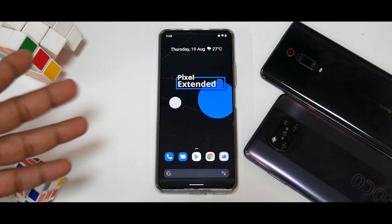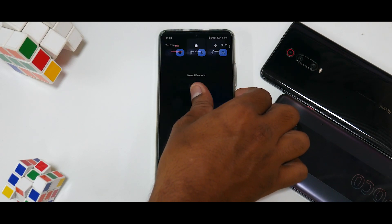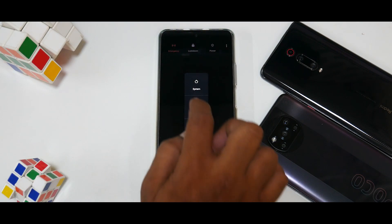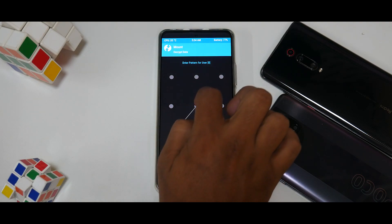Make sure you've completely removed them from your Poco F3 or Mi 11X. If you're on a Redmi K40 with a locked bootloader you should get this stable update if you're in China. This is for people in India and global markets where this update hasn't reached yet — hence xiaomi.eu to the rescue. Once everything is prepped and the files are copied to the phone's internal memory, press and hold the power button and go to Power > Restart and Recovery. Make sure you use the recovery linked in the description — Recovery 3.5.2 Nebraska — which has been working fine across a lot of custom ROMs.